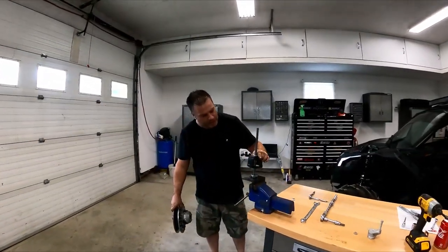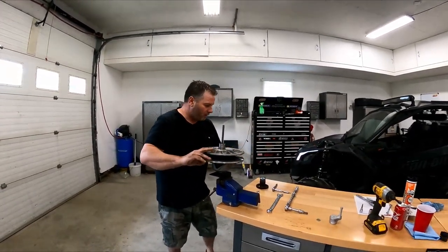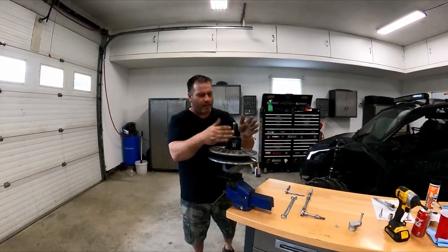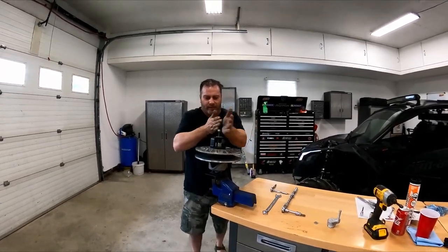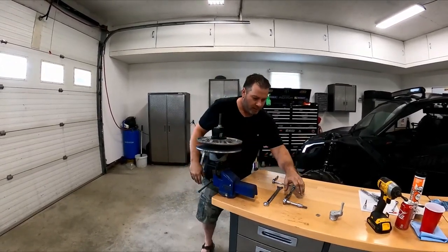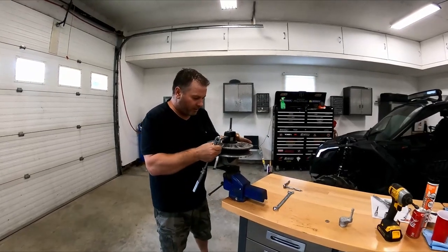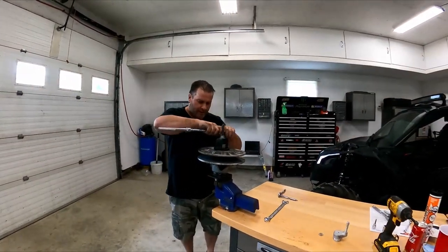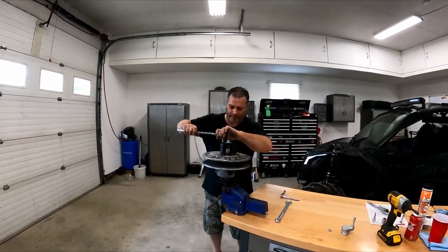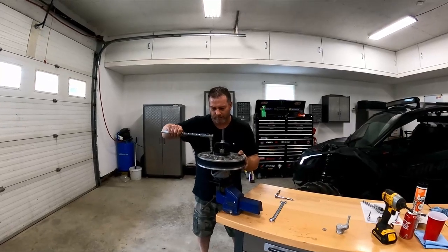Try out our new spring compression tool. Put it in upside down. Slap this on top. Take the washer. Grab the nut. Find that this is the easiest way to roll it down. Then we grab a T50 to loosen the back of it off. Shouldn't be on there tight. There we go. Came out nice. Try that on. Came out nice. And we'll do this one.